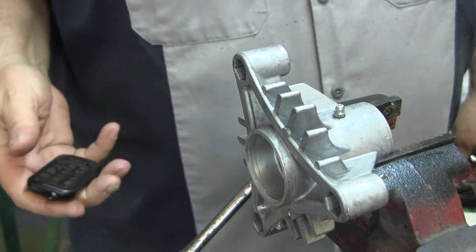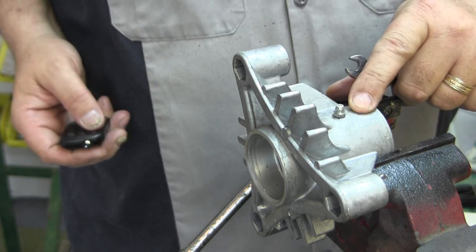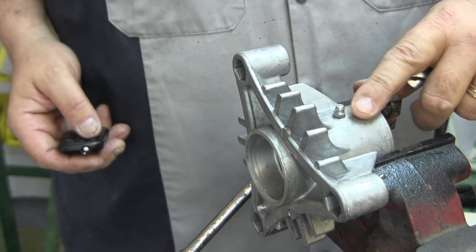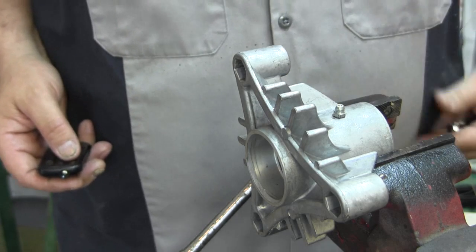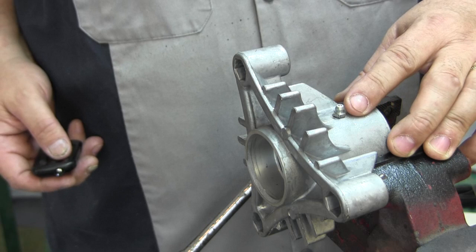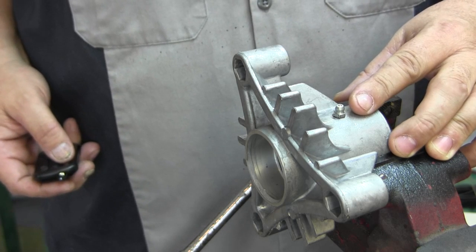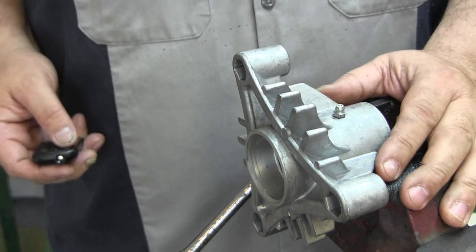I've got two more of them to do, and this will make your bearing mandrels and your bearings last the life of the lawn mower. I've done this on all my lawn mowers. You can buy a cheap lawn mower and do this to it — this is the weak link of your mower deck. They call them bearings on the pulleys, but they're not really bearings, they're just sleeves that are designed to fail very soon. You can go to some auto parts stores or old hardware stores and find pulleys with really good bearings in them to replace the cheap ones, and you could have a mower far longer than the people that made it intended.